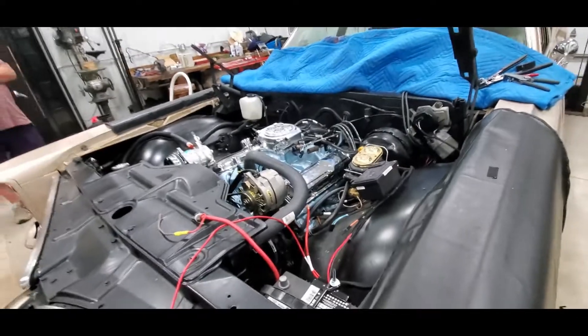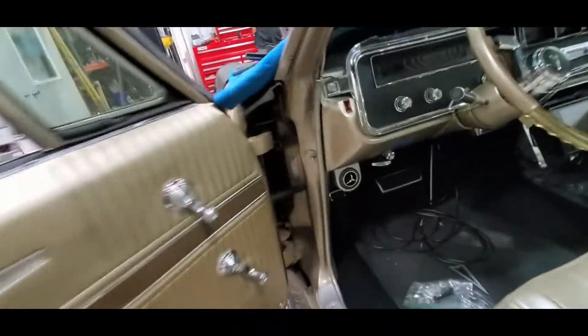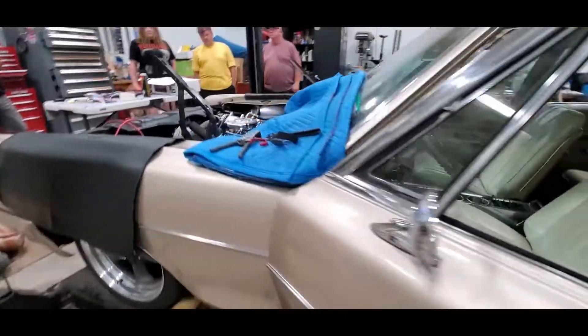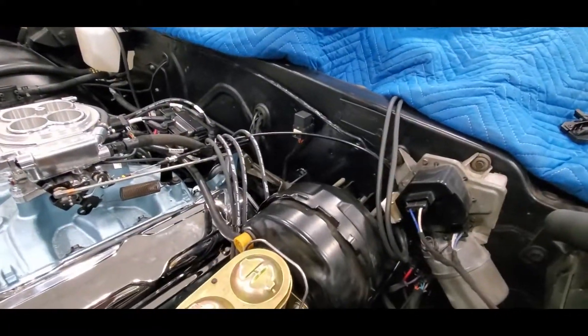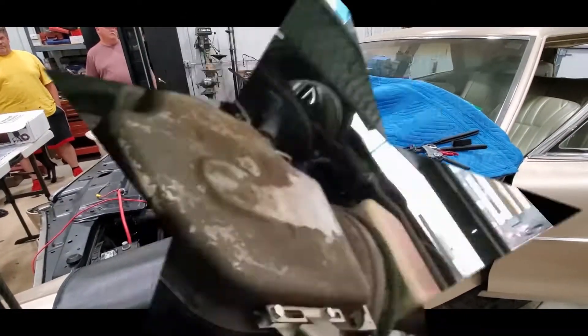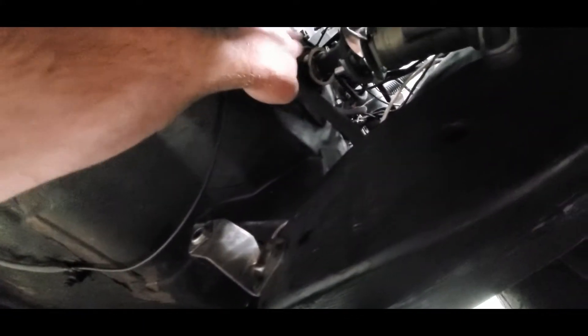You can see back here — next time the car is up I will loom that fuse holder. That's where Holley wants it. This is getting pretty close now — we're almost ready to build this harness, which we all know is very fun. Still got all these sensor wires to hook up into the Dakota but if you've ever done that it's only about 20 minutes of work. I'm going to get that fuse holder pulled away because I don't want that getting stuck in the linkage. This is now all routed, all loomed, all brought up — we finally got that fuse tucked. If that fuse ever blows, Kevin's got a fun time changing that — but that's the little fuse for the Sniper. We've got everything out of the steering — this is coming out pretty nice.